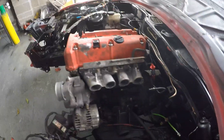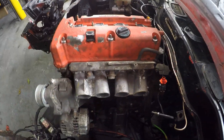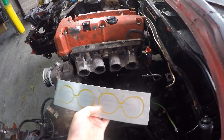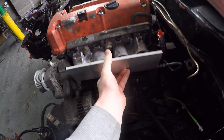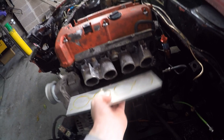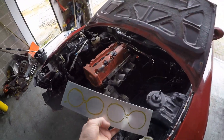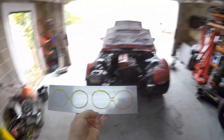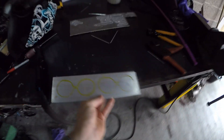As you can see, there are the inlets off the stock EP3 one. What I've done is I've just cut this off — I think I showed you that in a different video. I've got a bit of plate here with some port holes drawn on — just rough estimates. The idea is if I cut out those holes, this will fit on here and act as a backing plate. Once that's all tagged onto the manifold, I'm then going to clean it up and start on the next stage.